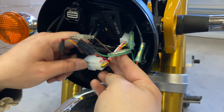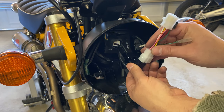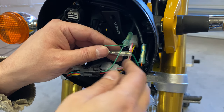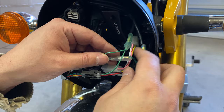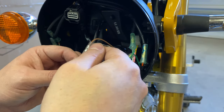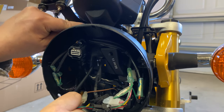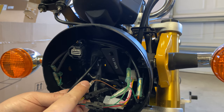So what we have here: we took the wire harness that came with the monkey kit, placed that end here, and it made the main connection. The green wires over here are to the left turn signal — spliced in a little bit of power there. Ran from the back up through, one connection goes over to the ignition, and then this connection is actually going to go down underneath — it's a temperature sensor that connects into the drain plug. This wire came off the tach, ran it through the center, and that connects into the actual harness, the temperature sensor, and the ignition coil.